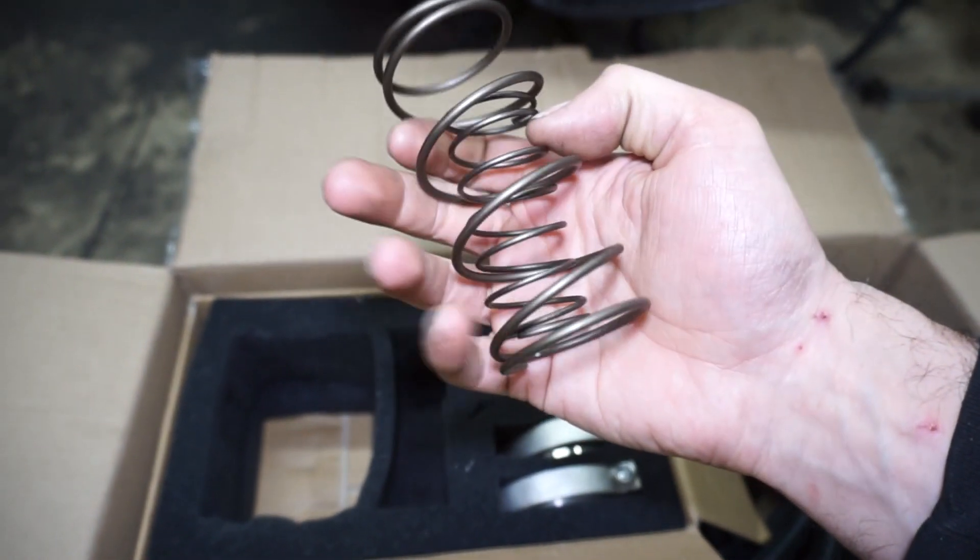We've got some wastegates — looks pretty sick. It comes out, flows nicely in, down into the wastegates. I did add that little extension piece down there to get the length I needed to put them in the same spot. They're pretty much in the same spot across and very close to the same height. Comparing to where the bottom of the radiator is, they're quite a bit higher than the radiator — basically right at the level of the balancer. Good distance from the ground and I should be able to just angle them straight towards the bumper where the dump's going to come out. Overall I'm pretty happy with how those turned out.